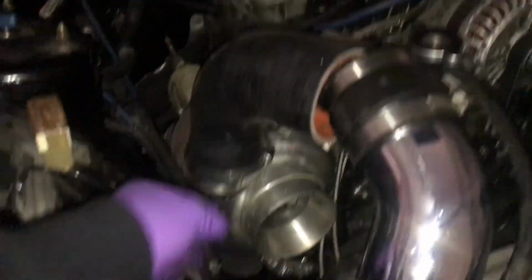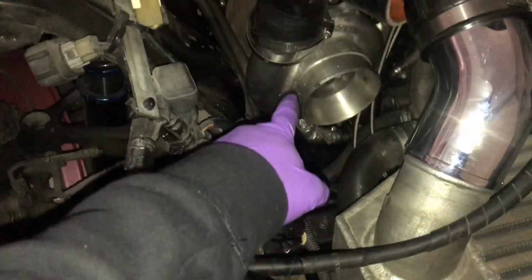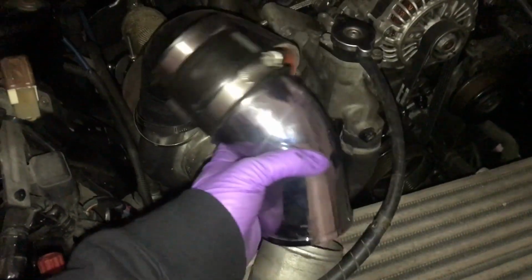We have enough to get it to go. So now I can start cleaning things up because there's metal shavings in that. I can start probably switching over those couplings to these. Actually, just need one because this side is going to go there. So it should fit, and we should finally have all the piping figured out for now. There's still some things I got to fix, but I think now I can load up the map, and I probably don't have gas in this car, but load up the single turbo map and hope for the best.